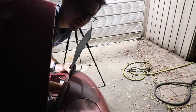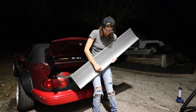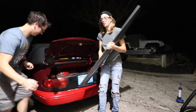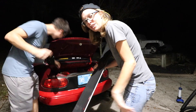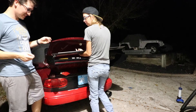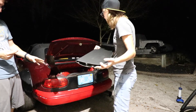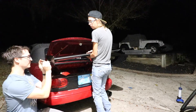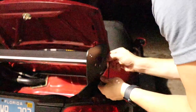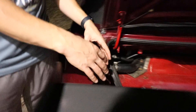It doesn't quite sit with the body line — it kind of sits with the top. So don't put it on the wrong way. You want the gurney flap in the back. With both of these loose, what we're going to do is install the wing onto this, and then we'll tighten it up from there. Now with the airfoil on, we can finally tighten these up. I'm going to do it kind of slowly on both sides, and then we'll lock it all down.